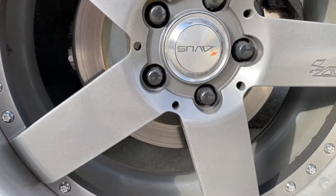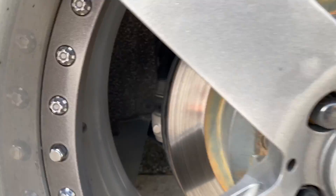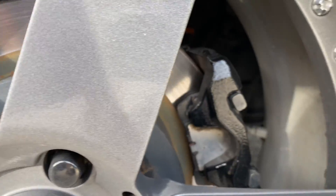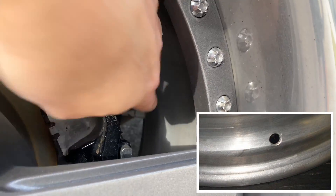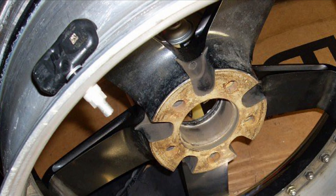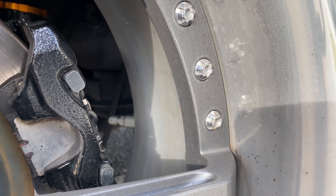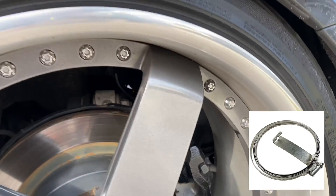On my three-piece wheels you can't really mount those sensors because the valve stem comes out at a right angle out of the barrel right here. So what you have to do on these wheels is drill the barrel back here right at the drop center where the tire mounts. I ended up drilling it basically opposite of the stock valve stem, and the sensor screws right back in there like a valve stem hole.